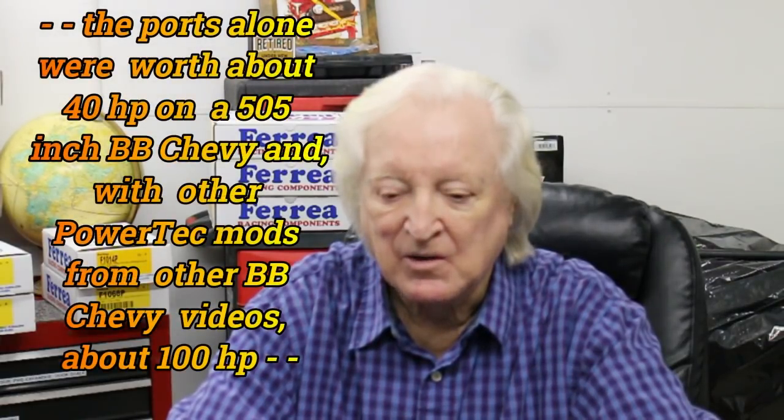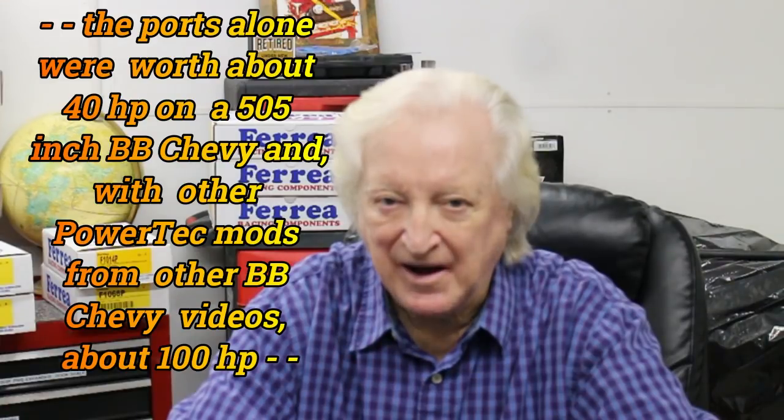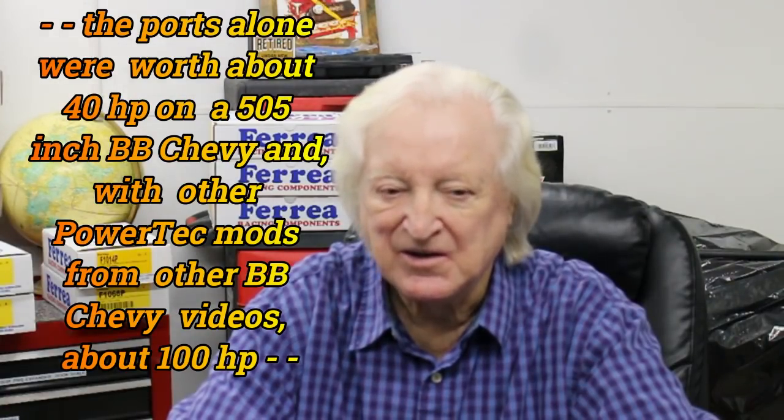A friend of mine that I did a pair of heads like this for went almost as fast without the nitrous as he did with a 150 horsepower nitrous kit. He was only about a couple of tenths slower and a few miles an hour slower. So the advantage is equal to about a 100 horsepower nitrous kit.